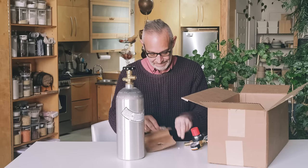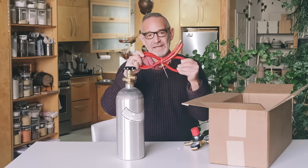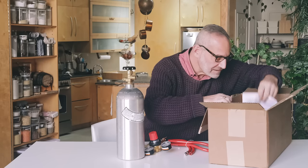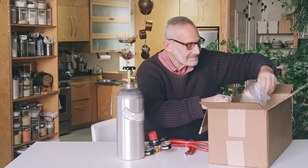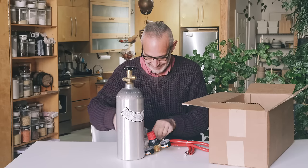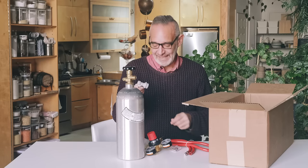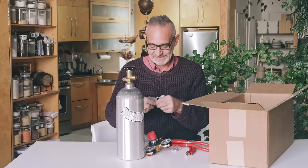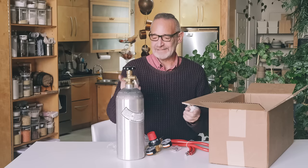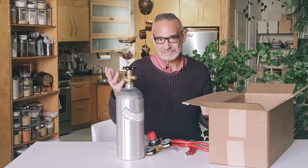The regulator has a little gasket attached to it. Now we have the hose — this will connect the tank and the regulator to the other devices. This is what's called a ball disconnect and it connects to this device which goes on to your pop bottle. This threads on, this connects to the hose, and the gas flows from here into your bottle — CO2 goes into your water and you've got carbonated water.